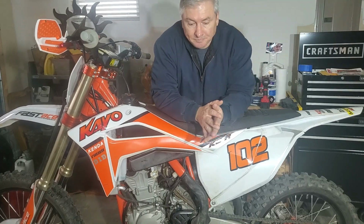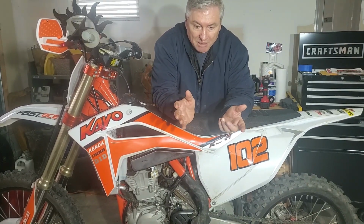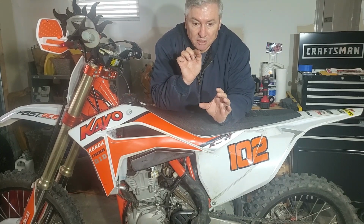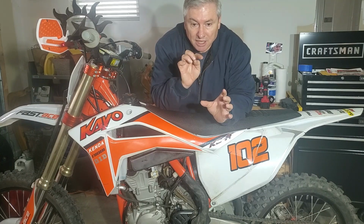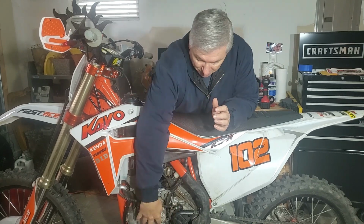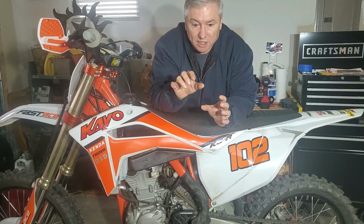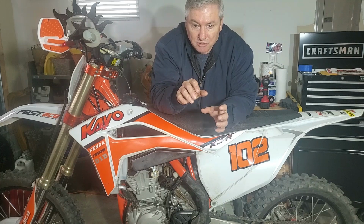So hey guys, sorry my camera messed up when I was finishing that, but after you put the key in, make sure you look with a flashlight that you have that key in the right position, that it lines up with the flywheel key and the flywheel. Put it back on the flywheel itself, torque it down to 56 foot-pounds. Make sure you do that.